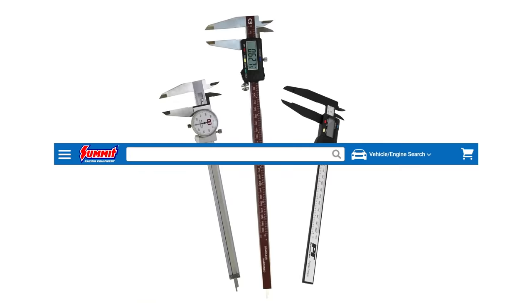If you're using a hydraulic lifter then you'll want to add the amount of preload required. If you're using a solid lifter with lash then you'll need to divide your desired lash by the rocker ratio and subtract that from your measurement. If you have a long set of calipers you can verify the measurement.